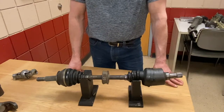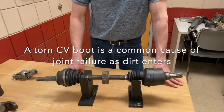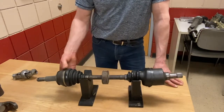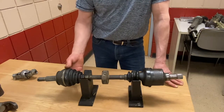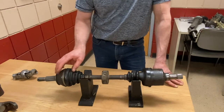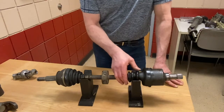What can go wrong with these is the seals can fail over time. So whenever we do oil changes or any kind of service on front-wheel drives, we want to check the condition of the rubber boots on the CV joints. I like to rotate them and get a light closely on them, parting the boot itself to check for any cracks or crevices forming in those boots.